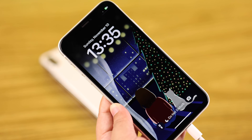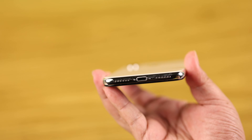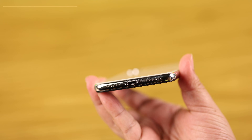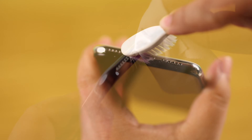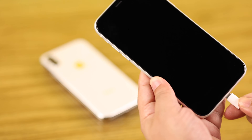You can test by trying another iPhone with the same charger. If that device is charging fine, then you need to look for any damage or dust in the charging port on your iPhone 10. You can wipe or brush it away, whichever is most comfortable or available to you.